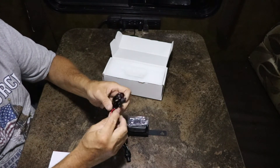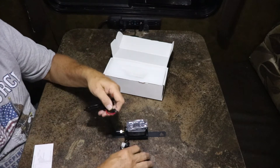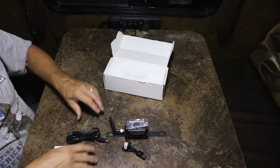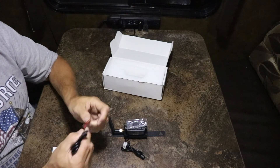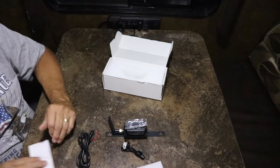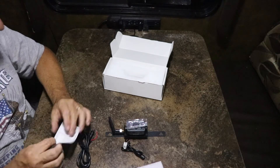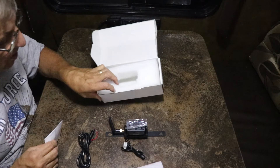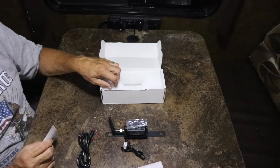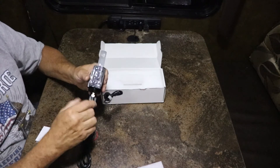It's got a grommet for wherever you're going to be drilling a hole. The power supply recommendation is to run it from the camera to your backup light — simply remove your lens and wire it to the positive and negative of your backup light bulb connector. The specifications are included, and those extra screws that came with the RD7 are likely the security screws — I'll let you know for sure.